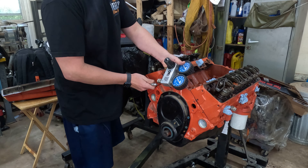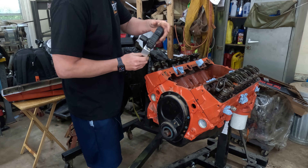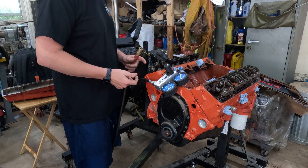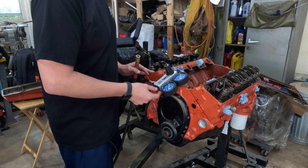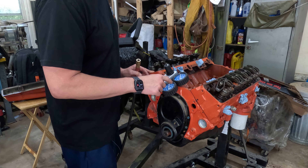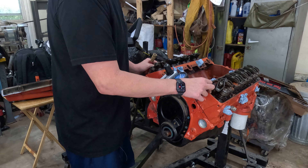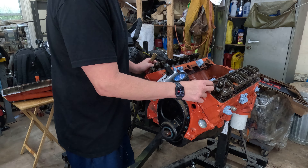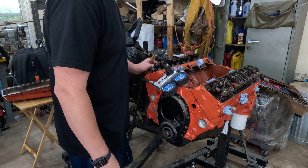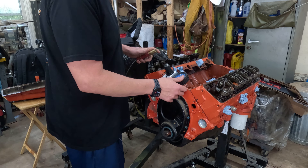So boom - out, put that to the side. Now we can thread this back to our engine block to seal a spark plug hole. Then we take our leak down device here, a regular air fitting coupler, and plug the air hose up here. This should be set around 100 psi and you'll have two gauges: your input coming in at line pressure, and this should read cylinder pressure. Since these have no push rods, we don't have to worry about top dead center. The engine might move pushing the piston down depending on where it's at, but we should get a pretty good percentage.